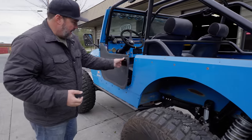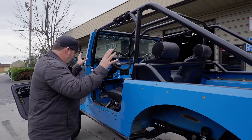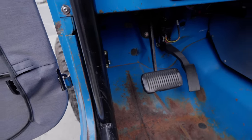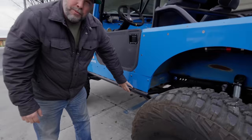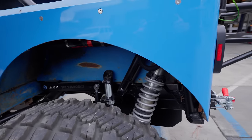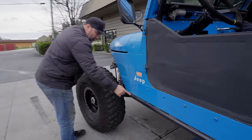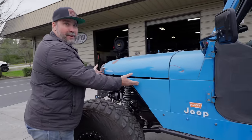This is where it gets really interesting. It's a pretty simple roll cage, but that tube goes right up to the front firewall — the seats are mounted on the roll cage so you're all buckled in. The rock slider tubing goes right to the frame, and shock hoops are mounted right to the roll cage, so everything is rigid. Basically what Clay did is make a full race car chassis — sliders welded to the frame, fenders attached to the sliders, so the fender is actually part of the chassis.